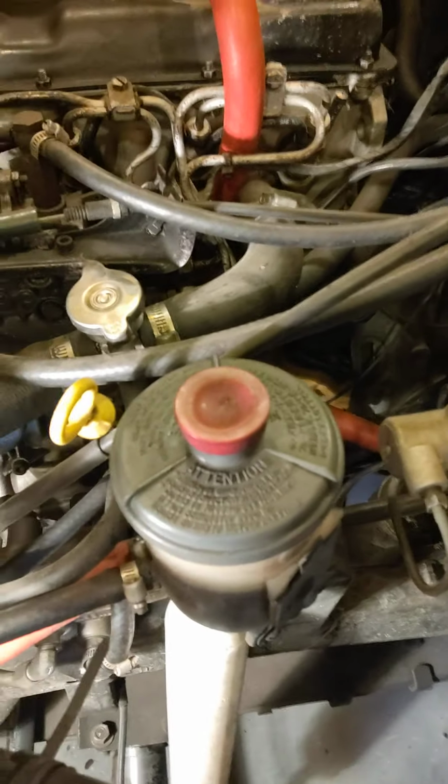I cut apart the pulley from the Honda pump on the lathe, made a plate, drilled some holes in the front pulley, and bolted it right to the pulley flange. Run the stock Honda reservoir, welded to my shock tower. And do yourself a favor and go to Napa or someplace you can have hydraulic lines made and have them crimped. Don't do the screw-on fittings. I did that and I blew a couple lines off and I polluted the trail in a couple places.